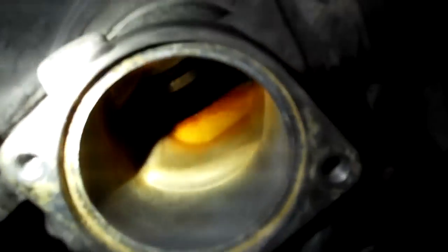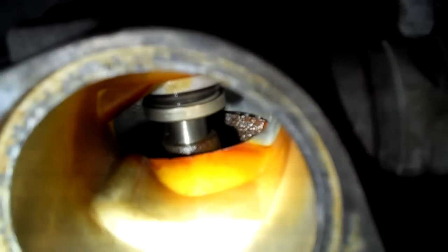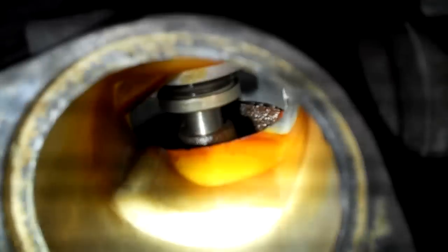This is your water pump and it's also your thermostat housing. You can see the impeller in there — this one's a little rusty, kind of crusty and brown looking. This is where you find your thermostat. The spring of it mounts up toward the engine, no matter what car you have.